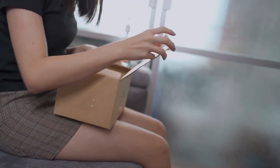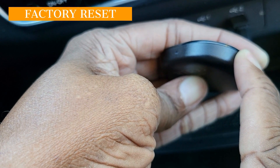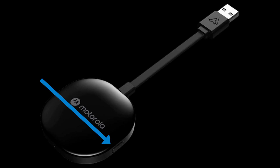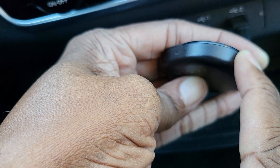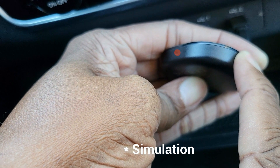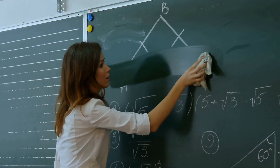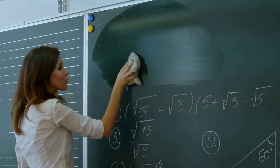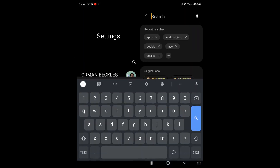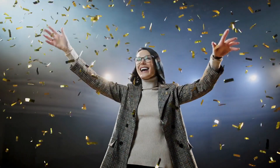If out of the box your unit is not flashing blue, or you've made some kind of problem and need to reset it, do the following. To do a factory reset on the MA1, press and hold the pairing button — be prepared to hold it for a while. First it will flash blue because it thinks you want to pair. Then after a few seconds it will flash red. Just keep holding that button down. Eventually it will flash yellow; at that point let go of the button. A few seconds later it will flash some more and then switch to a solid red. At that point, unplug the unit from your dashboard. You've done a factory reset. However, you will also need to erase the cache and data in Android Auto on your phone: go into settings, go to apps, find Android Auto, and click the buttons clear cache and clear data. You are now ready to start the installation process all over again.